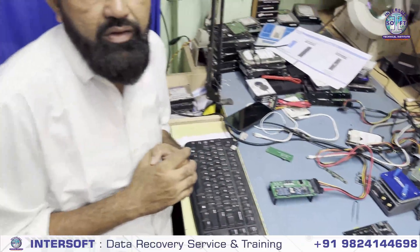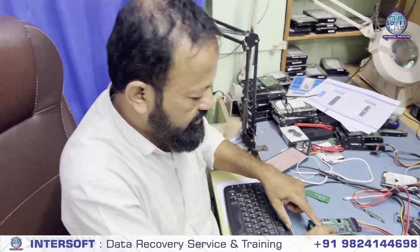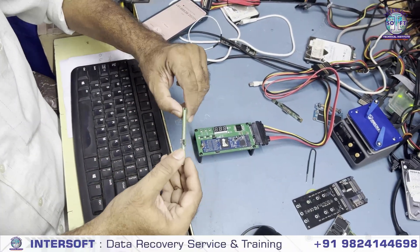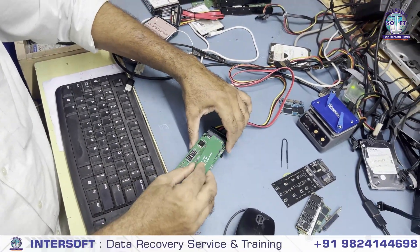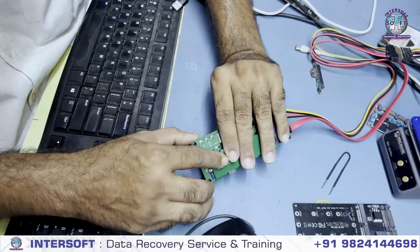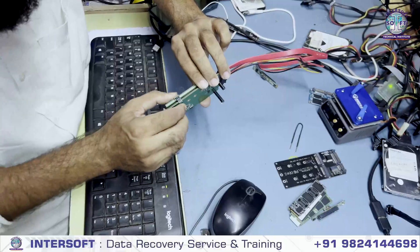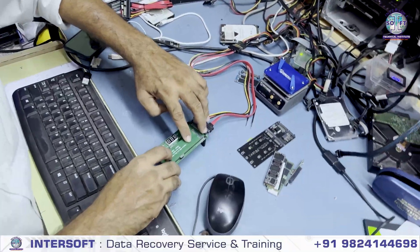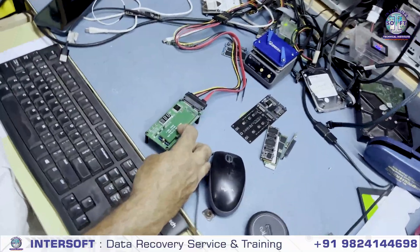Sometimes we have to heat the NAND chip. To give the NAND chip heat — if there is a dry solder between the NAND chip and the PCB — in that condition we have to give some heat to the NAND to read it. This is your NAND chip and this is your heater; it will heat the NAND chip depending on the controller. We insert this with the three-pin connector here, and here is also three-pin connected properly. Now it is connected — this is an adapter, SSD M.2 PCIe and SATA both converter.